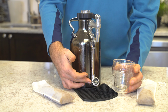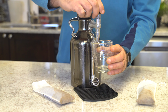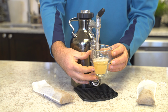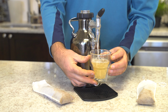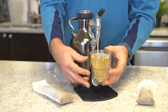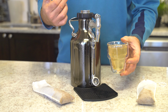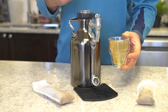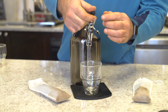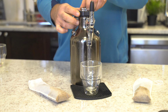And this part is to actually clean the front pouring mechanism here. So basically we want to reuse the remaining gas in the cartridge to start flushing the rest out until we have clear water coming through. Once all the water has dispensed, you can vent the remainder of the cartridge